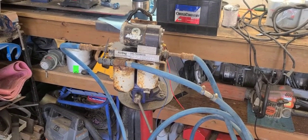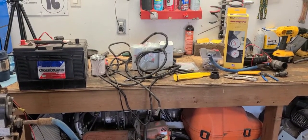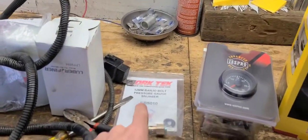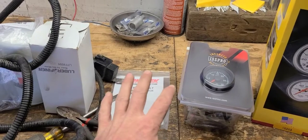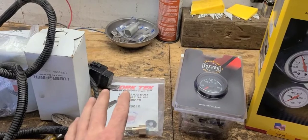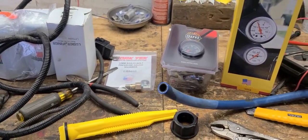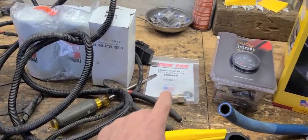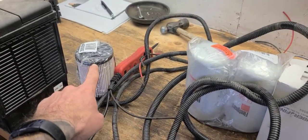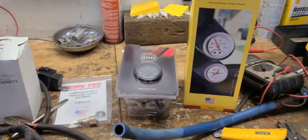Moving on - let's start with the fuel filter install, then I'll put the pressure switch in with the banjo bolt that's supplied and get my truck running again. Once it's running I'll worry about wiring the gauge, because I need it running at the end of today - I'm going fishing with it tomorrow. First things first: open up the fuel system, get that snubber valve installed on the banjo bolt, get the fuel filter replaced, get everything primed and running again, then we'll worry about wiring.